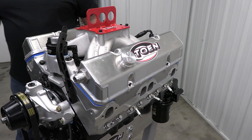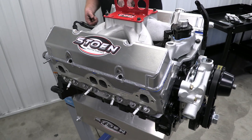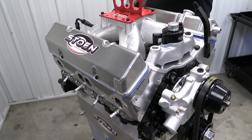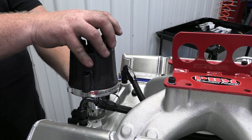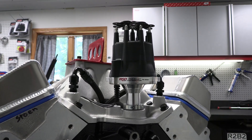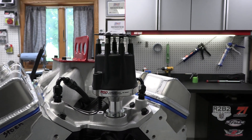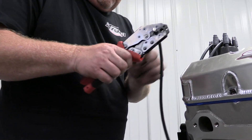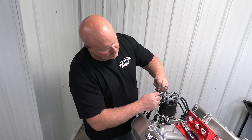Kevco — the same company that provided the racing oil pan — also fabricates these high-clearance aluminum valve covers. That AN fitting at the front is for the breather. An MSD Pro Billet distributor will be used to route the spark. Jamie doesn't worry about properly timing the engine right now; it's just stabbed into place so he can measure and cut the custom plug wires, since it has to come back out to prime the oil pump later and will be installed correctly on the dyno.